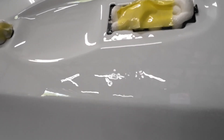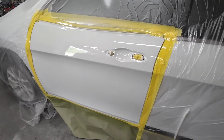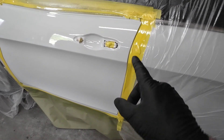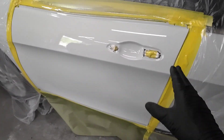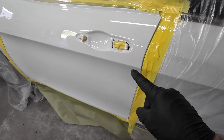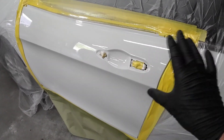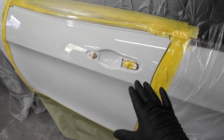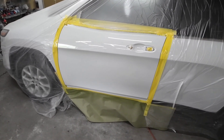Got a little fish eye there. We've got some kind of contaminant on there, even though I washed this like four or five times. I didn't see it after the first coat, because it probably happened in the first coat. I put the second coat on, which is fine. It looks like it started to cover it on the second coat. So I'm going to spray a little bit more clear on there — this is how we're going to correct this. One more coat. We're not going to run it. We're going to let it flash off really good. Now it's going to leave a little dry spray around here, but that's okay, because you can wet sand and buff that. An added coat of clear is going to give me more material to wet sand those out. But these things happen, and this is a good opportunity to teach you guys how to correct these things and overcome these kind of issues.